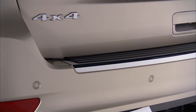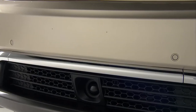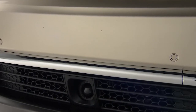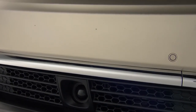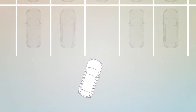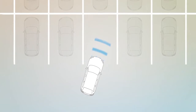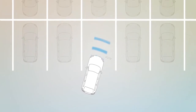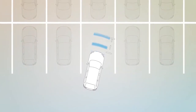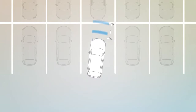The system uses sensors on the back bumper to scan for obstacles behind you. ParkSense sensors located in the front bumper monitor the area in front of the vehicle within the sensor's field of view. These sensors can detect obstacles from approximately 12 inches or 30 centimeters up to 47 inches or 120 centimeters from the front bumper in the horizontal direction, depending on the location, type, and orientation of the obstacle.